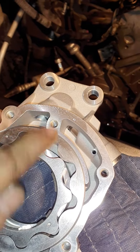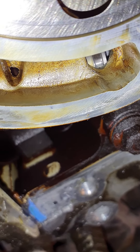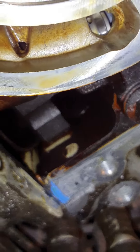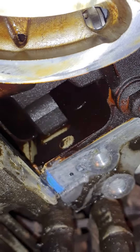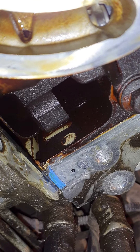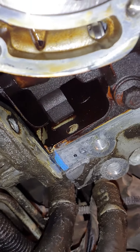On yours, see the pressure relief valve is open — just a little bit open like that. That's dumping all the oil pressure. That would be a major problem.